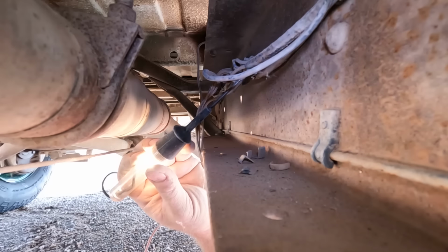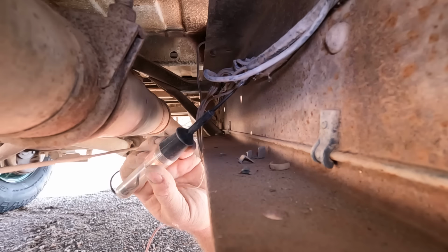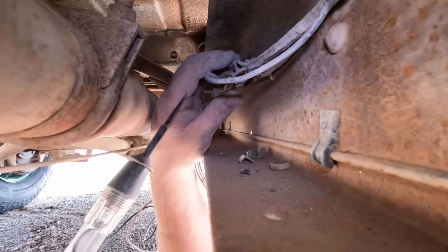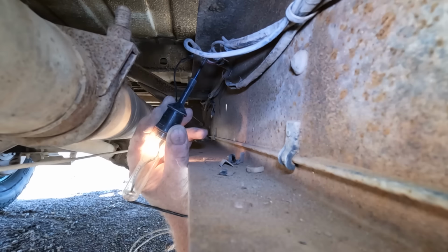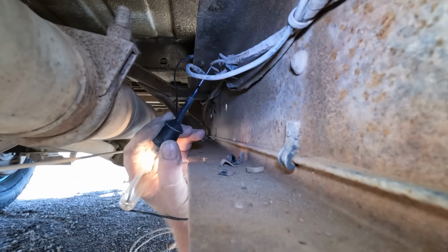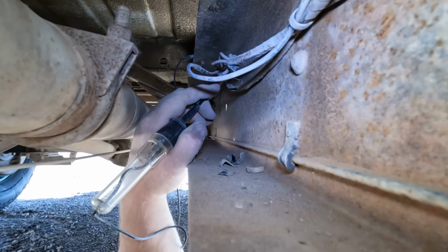I found a couple interesting things. I found a red wire that has power to it that is not connected to anything. I also found my three white wires I've been tracing. That one right there has power to it. Well, I removed this entire harness. Now this is definitely a white wire going to where the taillight is, and power's on it with the brakes applied, and we have power downstream, which means that connector was not actually the problem.